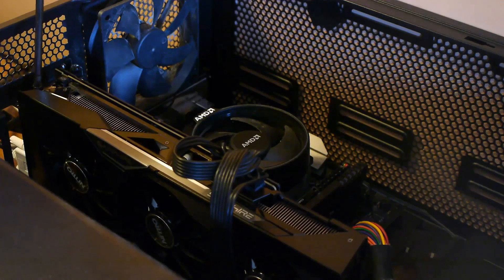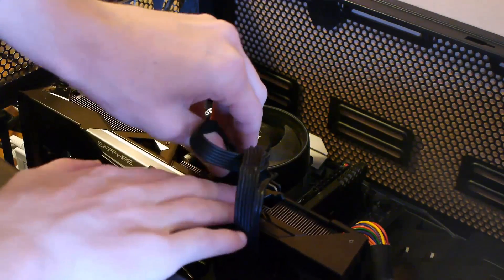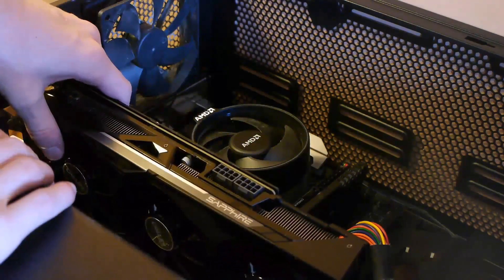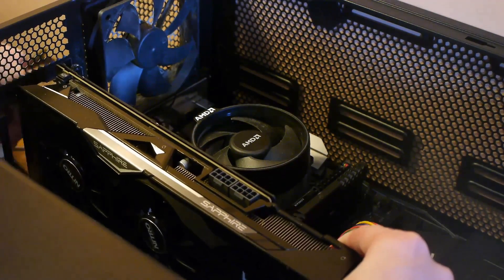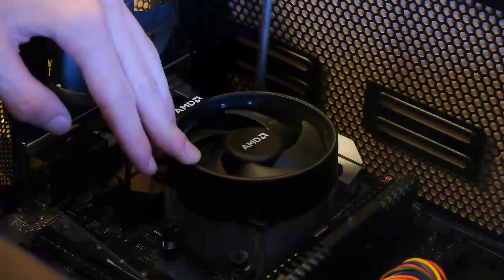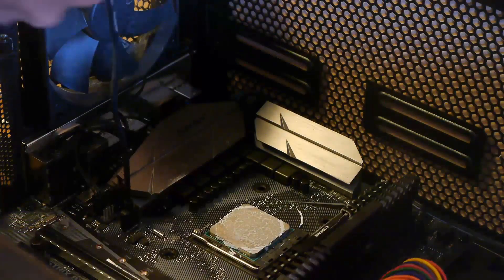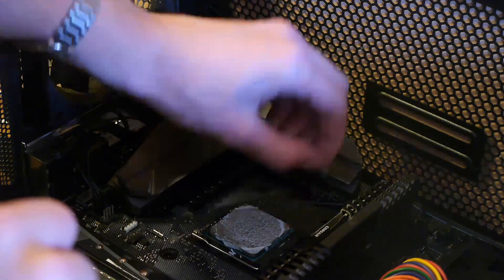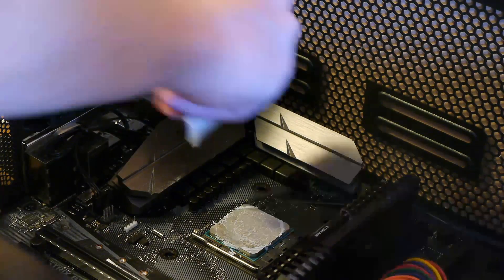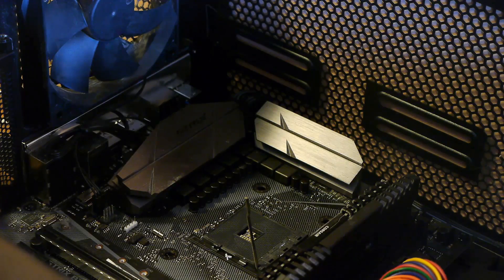We're going to be sticking this in my main PC, but realistically with no overclocking options available other than changing the base clocks and maybe some effects on the GPU cores, you're not really going to be able to do much regardless of the board you use. This really gives you the option to choose the cheapest A320 boards, as long as you update the BIOS to support this CPU. We're selecting a standard XMP profile of 2666MHz, which is a fairly representative setup of what a standard user can expect.